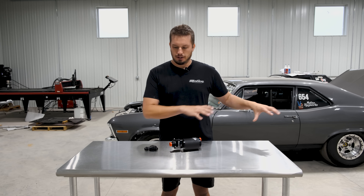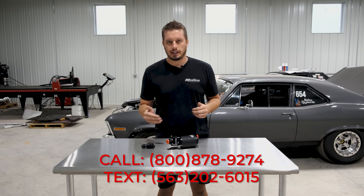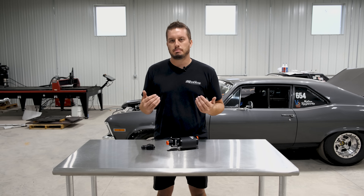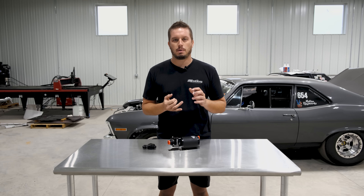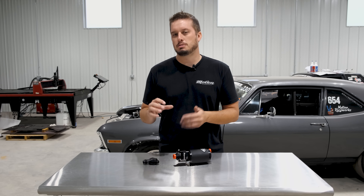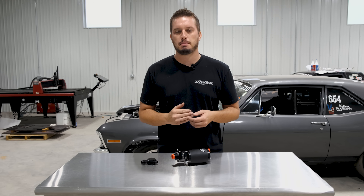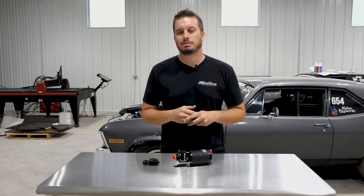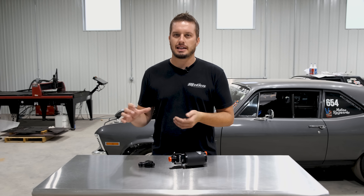If this seems like a huge plumbing problem, give us a call — we're happy to spec out a single pump that will handle all of your needs. I'm not personally a huge fan of dual or triple fuel pumps, because oftentimes, especially if set up incorrectly, one of those pumps can die. Whether it's an electrical wiring problem that melted a relay or whatever — if one pump dies, it's got just enough fuel, especially on boost, to keep the motor going but not enough to keep it from lean-burning, pushing a head gasket, or creating a fireball out the side of the motor. Just enough fuel is a really bad recipe for disaster. I always try to run one big single pump, because if that thing quits, the motor stops running.